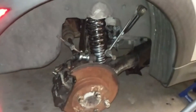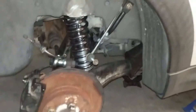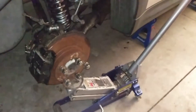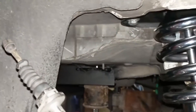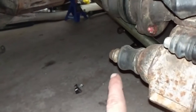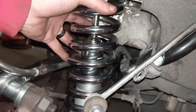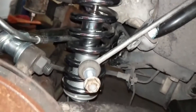That puts us at definitely rally styling with some pretty gnarly wheel gap — probably somewhere in the five inch range, which is about an inch and a half more than I was looking to have. We'll need to put some sort of strap in the back here, probably tie into that bolt from the original GSX coilovers and up to the frame rail. We'll put a bolt through there and tie a strap — basically like what the Baja guys do with a max droop strap, because since this coil doesn't actually have a limited droop stop, it'll over time probably fatigue itself.